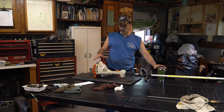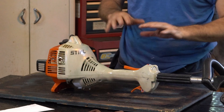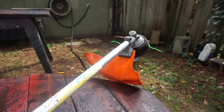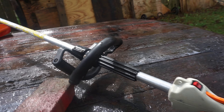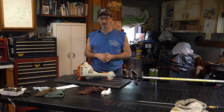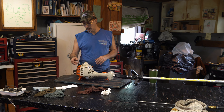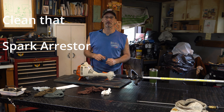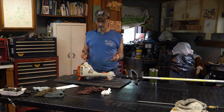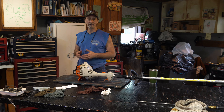I sprayed a little bit of engine enamel clear coat on the plastic - going to let it dry while I cut the lawn. When I come back it'll be fine. That's just to protect the plastic a little more since we got it clean. Running really good. Dump your fuel if it's been sitting a while. We did a quick tune-up - if yours needs a little more service, take the muffler off or go inside the muffler and don't forget to check that screen. If it starts to give you problems you'll know - you'll have a hard time starting it. Just shows her age, just like me - we're a match. Thanks for stopping in; don't forget to hit like and subscribe, leave a comment, let's build the channel together. See you guys later.